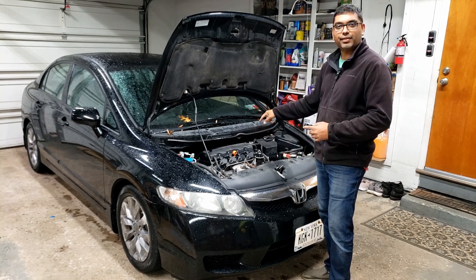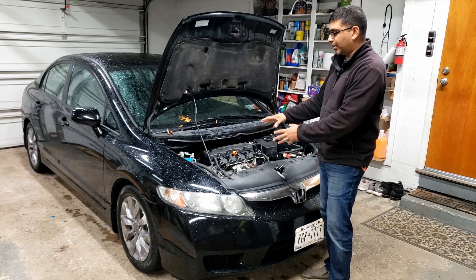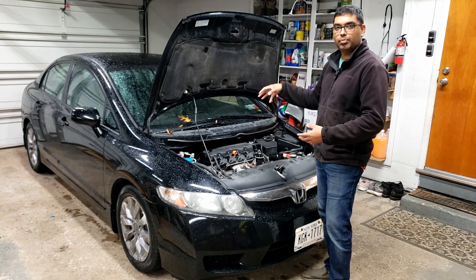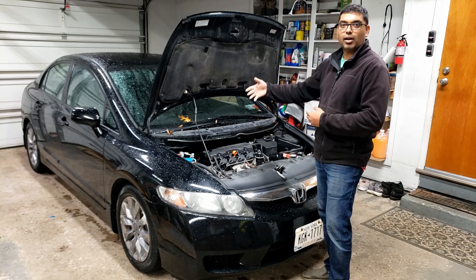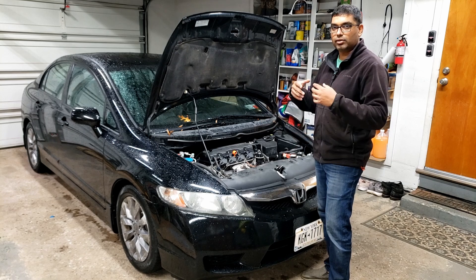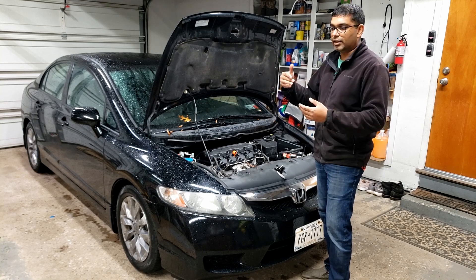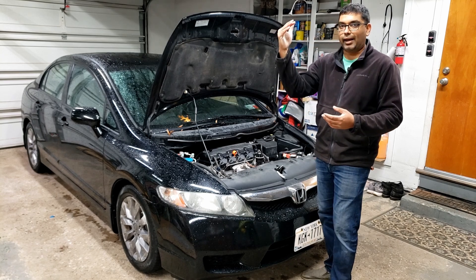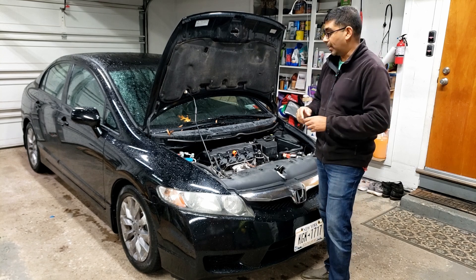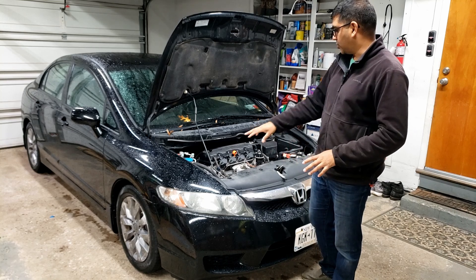This car has an electronic throttle body — a drive-by-wire throttle body — so you cannot really take it apart and mess around with it. Before you do anything, you have to disconnect the battery. After you take the throttle body out, clean it, and put it back, you have to use a scan tool to activate the throttle relearning procedure. As long as it's not crazy gunked up when you put it back, it shouldn't do anything crazy. But if it's too gunked up, the computer will have the RPMs high, because over time when it gunks up, the computer learns the new throttle position and compensates for the stickiness. So when you clean the throttle body, it's always recommended to do a relearn.